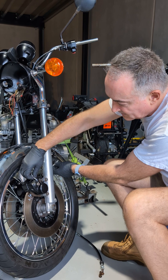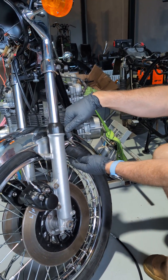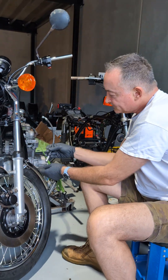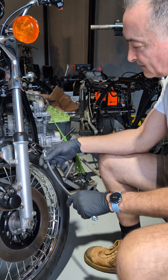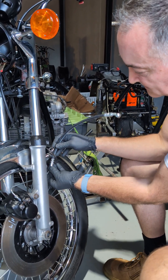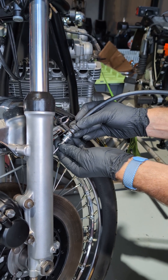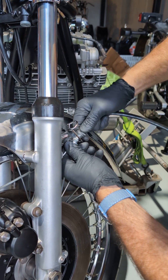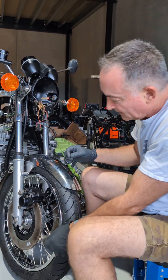We fit the pipe into the top of the caliper — you can see it bends around like this. We're going to fit these in finger tight. The hose fits through this little bracket here that holds for the speedometer, where the speedometer cable comes down and connects. The brake line comes through this bracket, giving us a screw fitting that connects to the threaded line. Feed it up — this rubber grommet will be our nemesis for the moment — slide that back and into that hole just like that. It'll want to connect as soon as you get it in correctly. The rubber grommet comes up over the top.